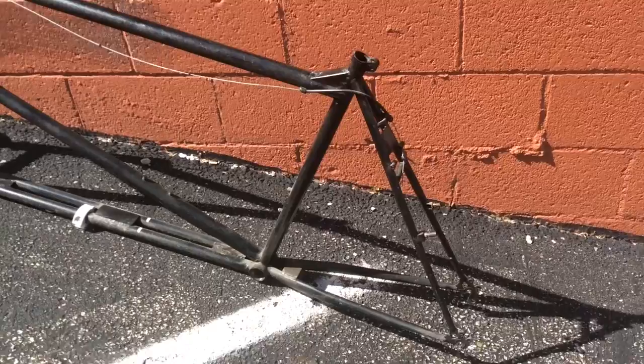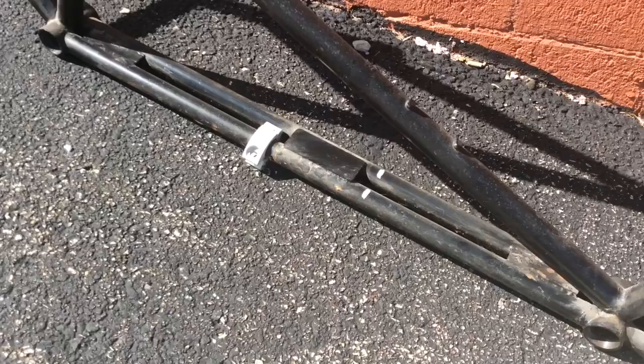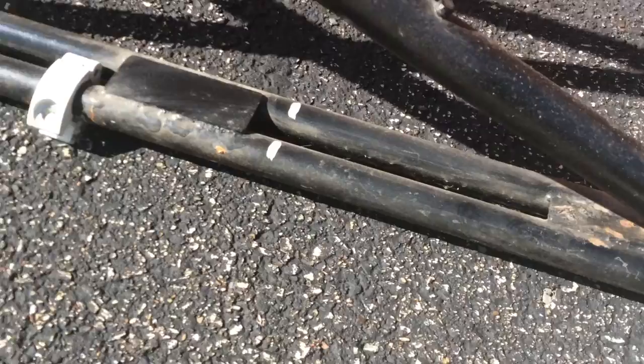Dual 26s, and really designed for two very tall people. Another thing I would do just to stiffen it up a bit more is to use a rear triangle with shorter chain stays. Connecting the two bottom brackets are two giant one-inch tubes spaced as far apart as you can without interfering with the bottom bracket.